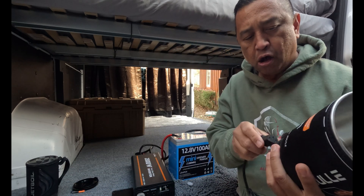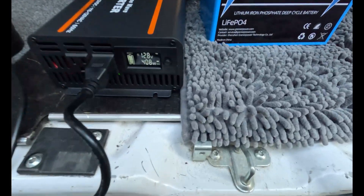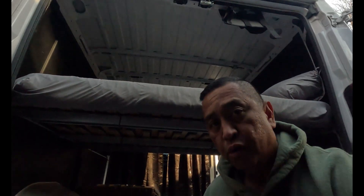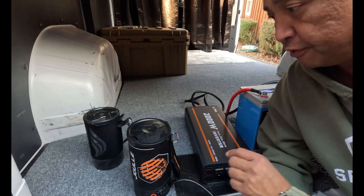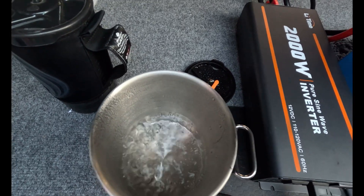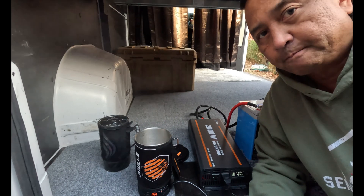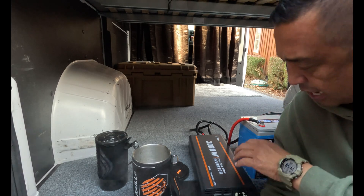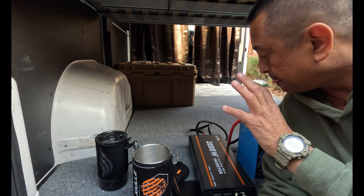Let's bite into our little dumpling first. So the Joulle is awesome. If we look at our inverter — 407 watts off the Joulle. When it's in drink mode and done boiling it will do an auto shut-off, and I can hear it boiling right now. You can probably see it boiling so it will be shutting off in just a second. And there it goes — it just shut itself off, showing zero watts now on the inverter coming out of the battery.